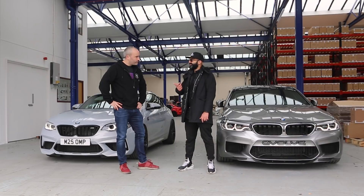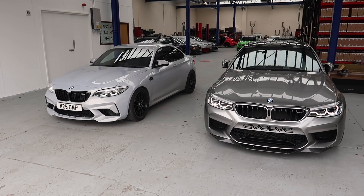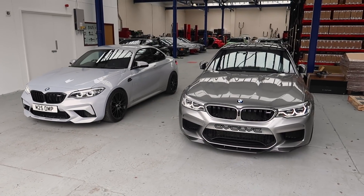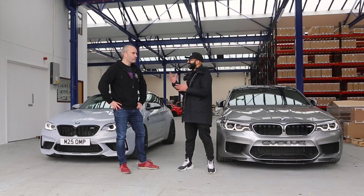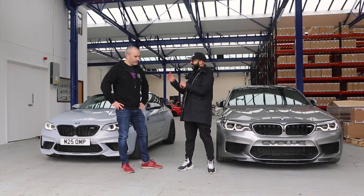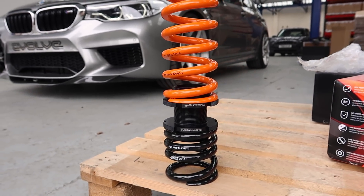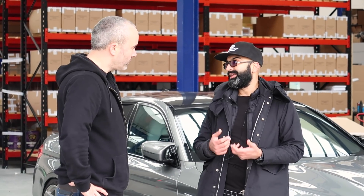As you know, when you fit a normal set of springs to the car with stock dampers it is a bit of a compromise. With the MSS we feel there's no compromise, and the reason for that is you can adjust the height because they've got adjusters on them. The trick thing about them is on the rear suspension they have two separate springs that have three spring rates. One spring has two different spring rates, and then there's another spring stacked underneath it which has another spring rate, which in our experience just helps the car maintain the contact patch with the road, giving superior comfort and handling.